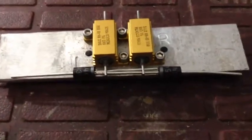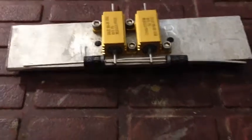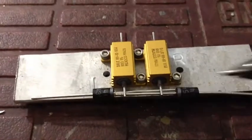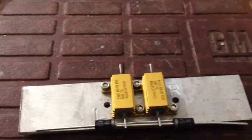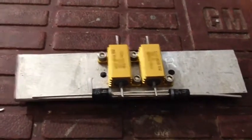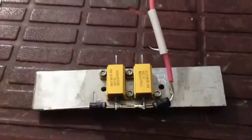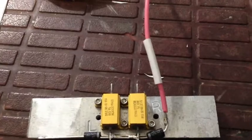In this segment I want to do a little bit of soldering. These diodes have to be soldered to the resistors, but they have to go on a certain way. You'll notice there's a band on each of the diodes — those bands have to be toward the terminal side of the resistor block. If you put either one in backwards, the circuit will not work; it'll bleed back through to the other side, so if you turn on the right, the left would blink too. These diodes block the current between the two sides — left and right blinkers — without them, all blinkers would operate just like a four-way.